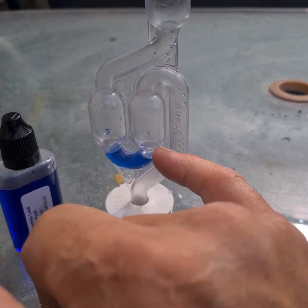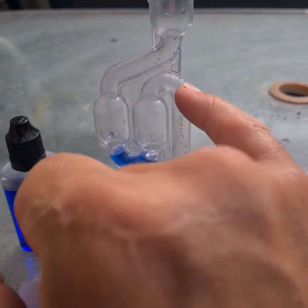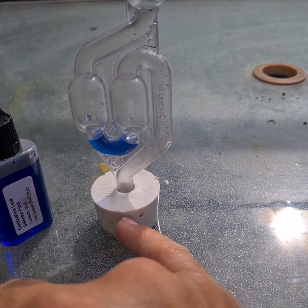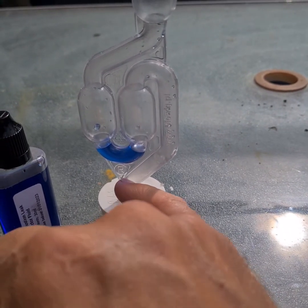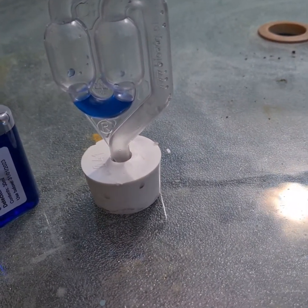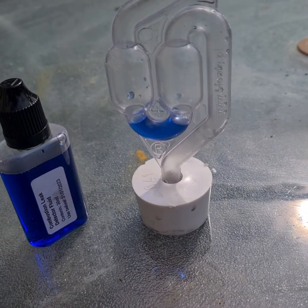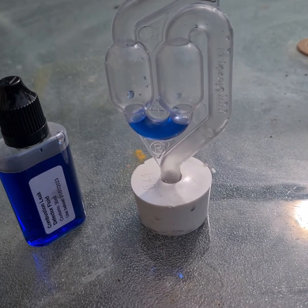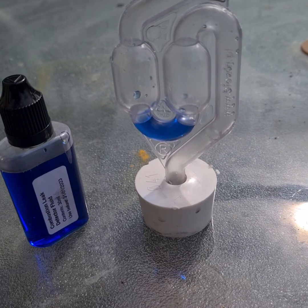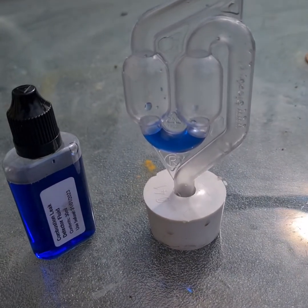You put the liquid into the tube up to the line, and it's a sealed vacuum so air can't bypass from one side to the next. This goes into the top of your radiator or sealed reservoir tank on your coolant system. Gas comes up and has to pass through the liquid. The instructions say positive proof of a leak is when the fluid changes color on detection of CO2 gas — if there's a hairline crack in the cylinder head, engine block, or damage to the head gasket, the test fluid turns yellow. It should have about 15 applications.